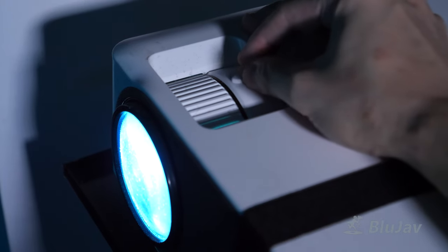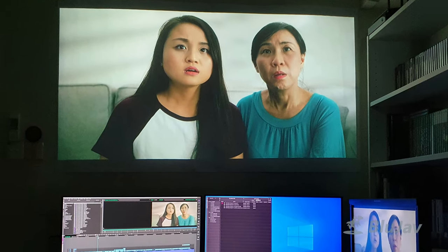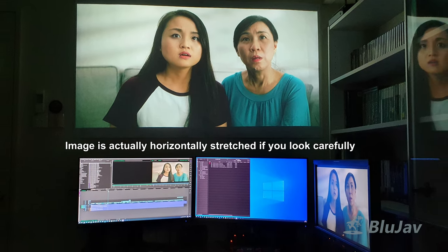The problem is that you only have vertical lens shift on the Auro projector and no horizontal lens shift, which is a little disappointing. There's also no zoom lens, but that's to be expected for a budget projector. I had to use horizontal keystoning in my home setup, and even then the image still appears more horizontally stretched than a proper 16x9 image, which is also very distracting. So essentially, if you are using keystoning you're going to have a stretched image that is also a lower resolution — not ideal at all.